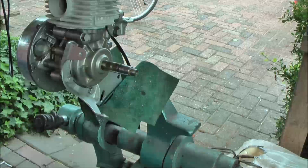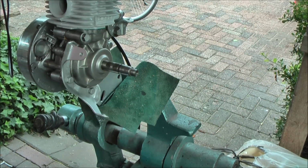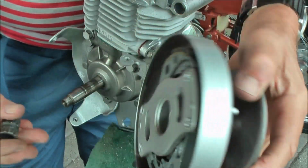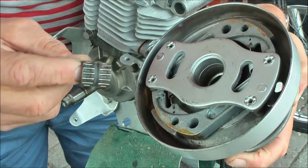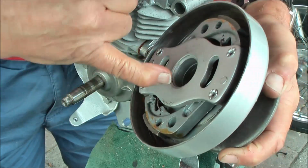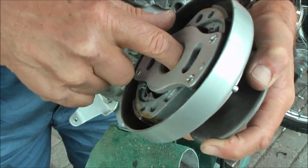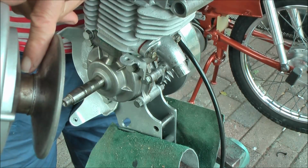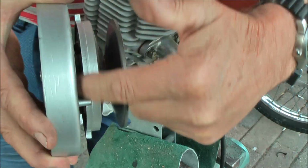Now there is the clutch side that still remains. It should be done in the right order and with the right set of washers. Okay, this is the clutch, and the manual says first to put the needle bearing inside. I put grease everywhere. That's after having cleaned the whole thing. I put some grease over there, and this was greased also.